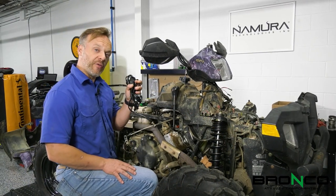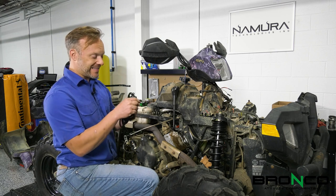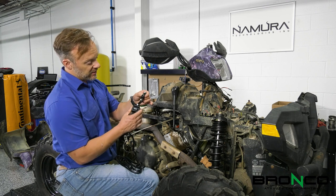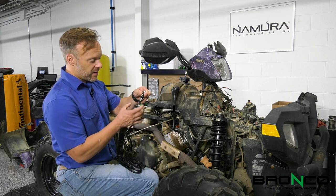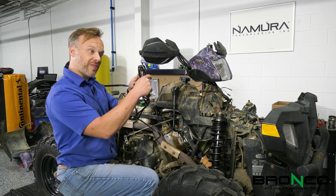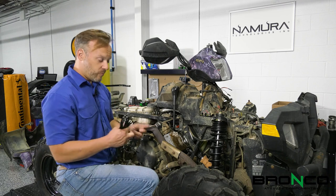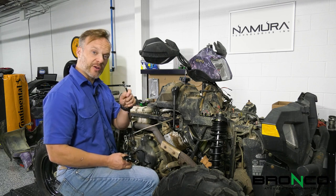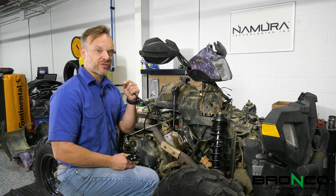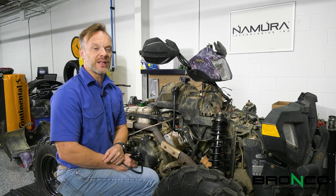The next piece: we need a way to control the winch so that way it doesn't run away with us. It's a pretty simple switch — out and in — and it's going to mount to the handlebar, meant to hang underneath so you can just hit it with your thumb. There are two screws here that help it clamp down on the handlebar. The bottom one helps it adjust so you can put it as close to or as far away from where your thumb is as you need. From there, we're going to run this cable down the handlebars and snake it through here, out the bottom. Once we get all that done, we're going to attach this to the solenoid. This is one of those areas where I'm always going to tell you to spend a little bit of extra time so it's going to look that much cleaner and you won't have any issues with the installation down the road.